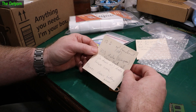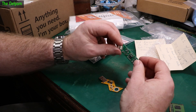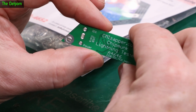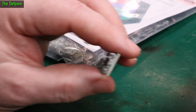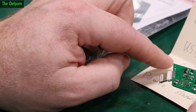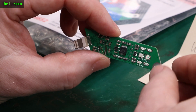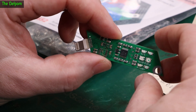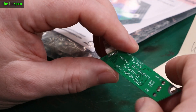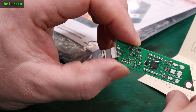So he's got the new version of this — this is the new thing. It's a lightning port tester. This is what I commented on saying I'd like to get one when he's actually finished development on them, and so he sent me one — very nice. This is an early revision. It's got some lights on it: Power, ID1, USB data. He says ID1 not functional yet. USB data blink shows that all or almost all data lines work. In other words, if the data light is going on and off, there's some communication between the phone and the port. Power shows that it's got power from the battery working. I need to basically plug it into an iPhone now.